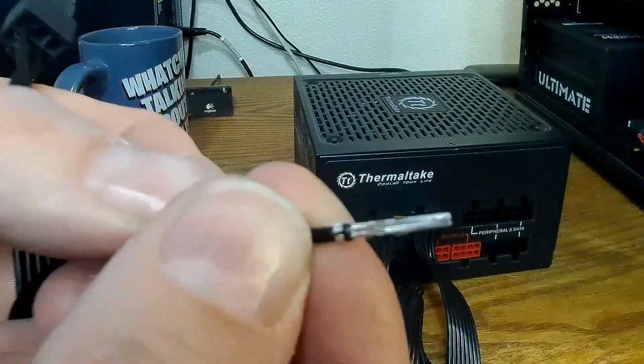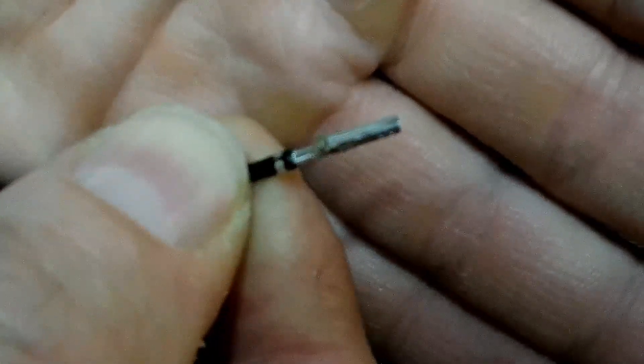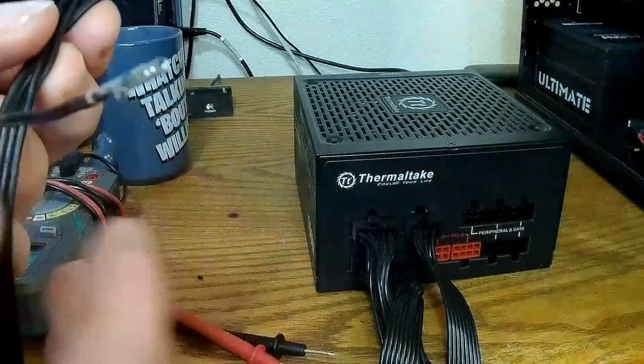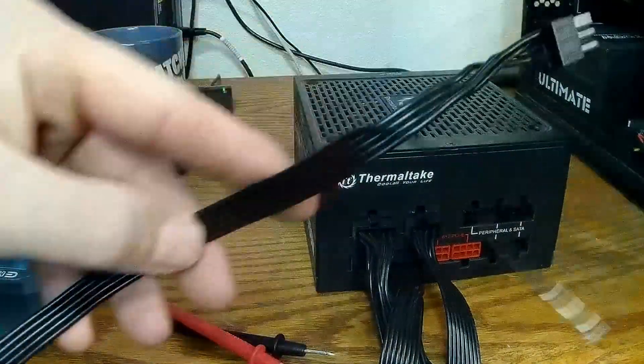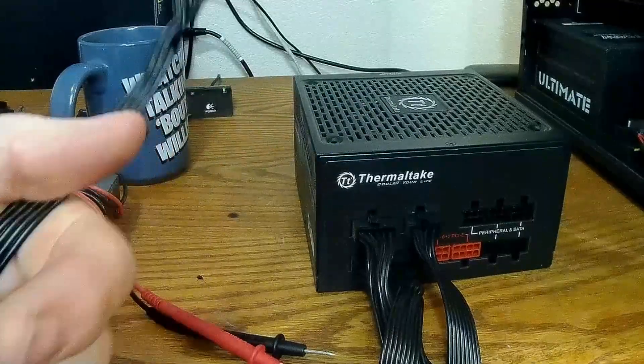As you can see, there are these little wings that stick out — those two little tabs — that's what locks the pin inside. This makes all your miscellaneous modular power supply cables compatible with all major power supplies, because you can change it over yourself.